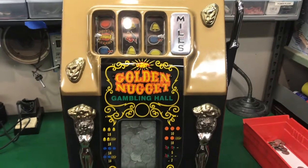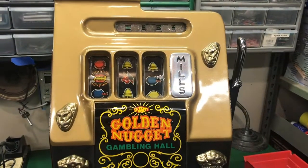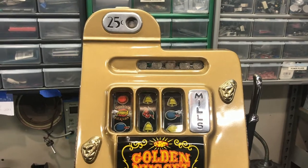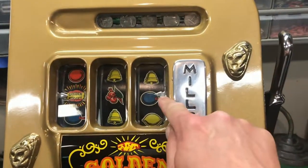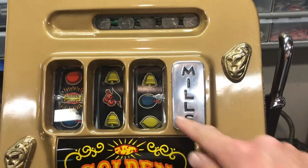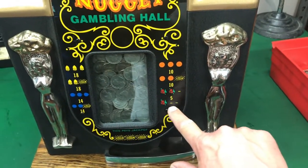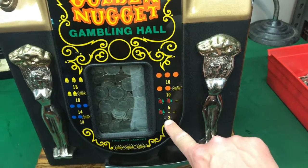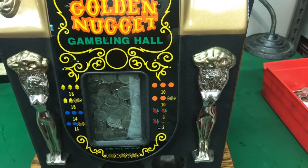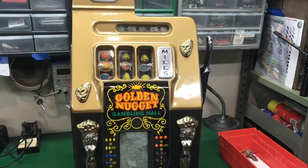I'm going to work a little to free up the wheels so they spin a bit better without complete disassembly. The next step if it doesn't free up would be to take the whole assembly apart and make sure everything is lined up right — if the plates and reels aren't lined up properly it's going to show the wrong thing. The payouts always go left to right: one cherry pays out, two cherries gets you five. You can never have a right-to-left payout without it being a digital machine — this is purely mechanical. Thanks for watching, just a few more things to do before I get this back to its owner.